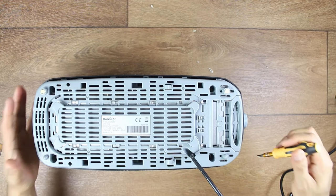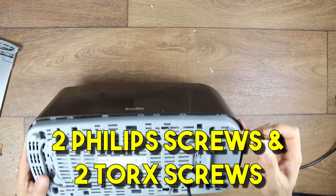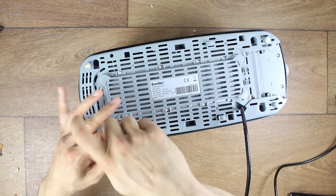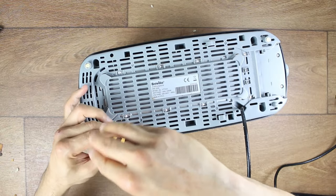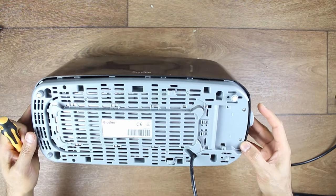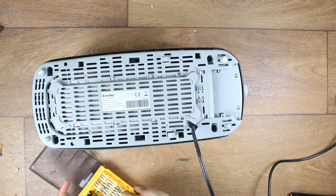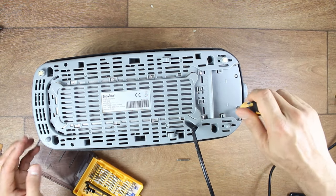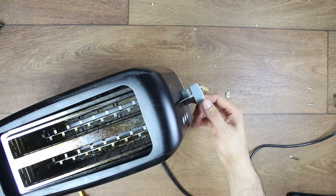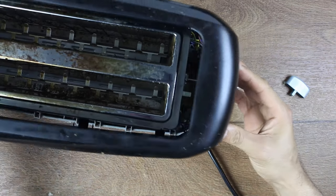There would be different screws depending on your make and model. First of all, remove your tray. You've got two screws here, and then three and four screws. That's a bit of a problem - manufacturers keep putting in weird screws to prevent or at least discourage you from opening your device. It's quite ridiculous, under the guise of safety. You'll need a different screwdriver set - I'll put a link below. Once you've got the screws out, you may need to remove the lever to take the top cover off. Pull the clip out and open up the top.